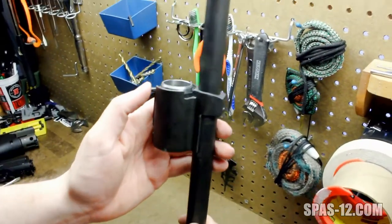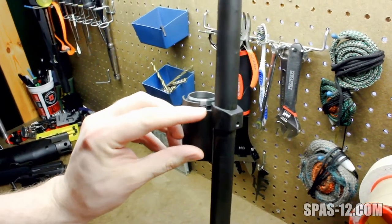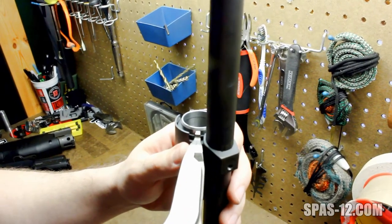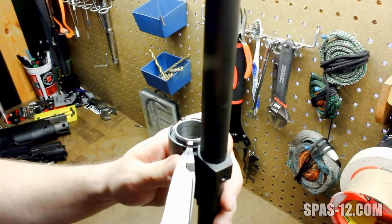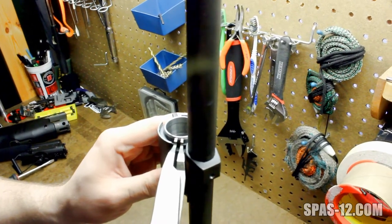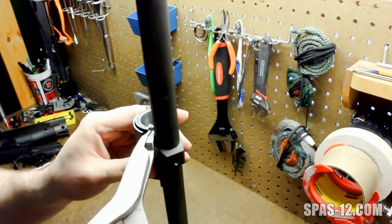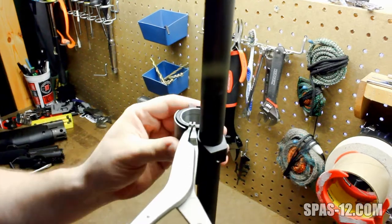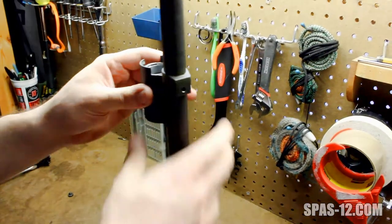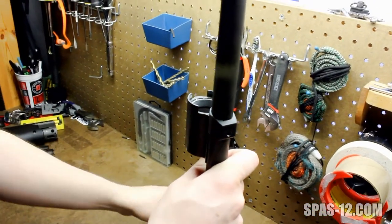What you're going to do — you can see this split right here — is take these expanding pliers. They really are the perfect size for going in there. This can get a little squirrely and sometimes this thing can shoot off; it is on there really well, so we're going to be really careful. Spread it and then lift it, and your gas valve will fall out. There's also a friction spring in there — you'll want to set that aside.